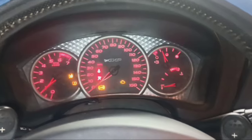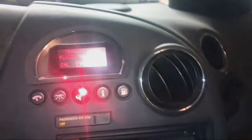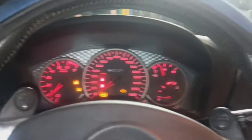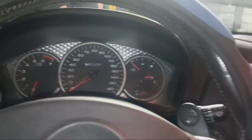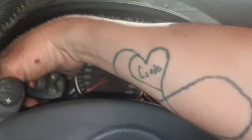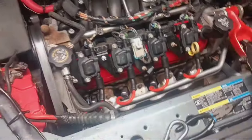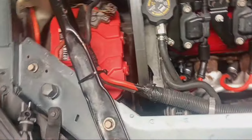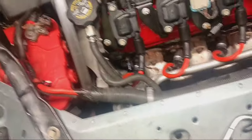It doesn't really seem like it's running any better, but it's alright — at least it has some new stuff on it. I replaced the front valve cover gasket and it actually looks really clean inside the front head, so pretty happy with that. I did notice that the very far left rocker was kind of loose. I tried to snug it down — it was tight — so it's probably just a trunnion going out.